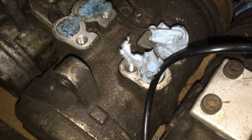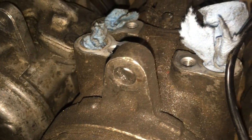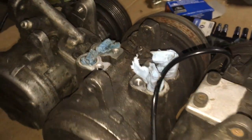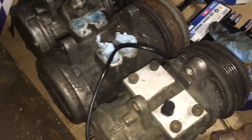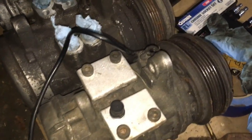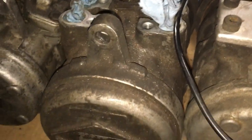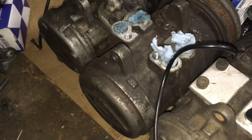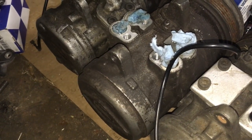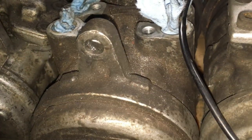I have this bolt drilled out now. As I mentioned originally, I just wanted to replace this compressor entirely to save me from having to drill out this broken bolt. But unfortunately, the only compressors that I have in working condition are later ones, and they don't fit on the early bracket. You can see that the mounts are a little bit different, and also the bolt holes are different sizes. So I'm going to talk to the owner and see if he just wants to replace this compressor altogether, or just wants me to clean this up and drill that bolt out after all.